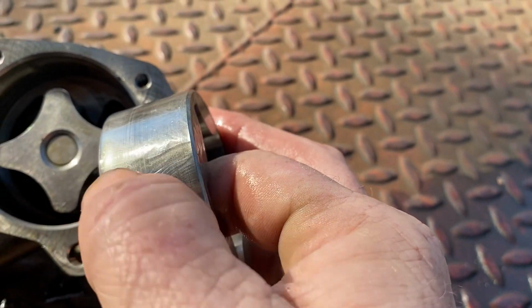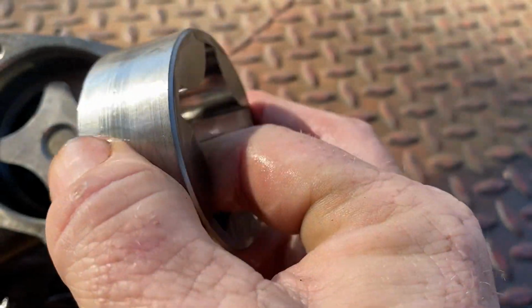Could the oil pump have been bad in this motor? Okay, so I'm not a guy that is an oil pump machinist or engineer or whatever you want to call it. I'm smart enough to know if you take an oil pump apart, you can see what went through the engine. And they're very simple in how they work. There's just 2 little gears in there. So the question becomes, how did that oil pump, just starting up on the dyno, seeing there was very, very little oil pressure, and then shutting it off, how does that oil pump have a wear mark like it on the outside?